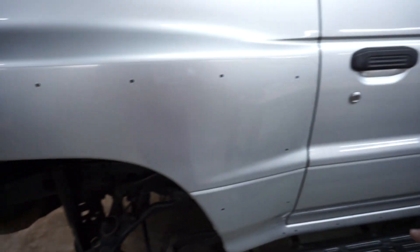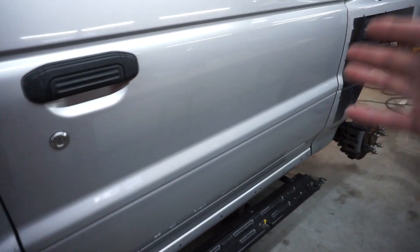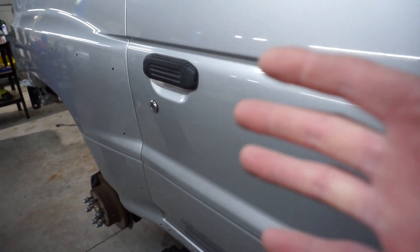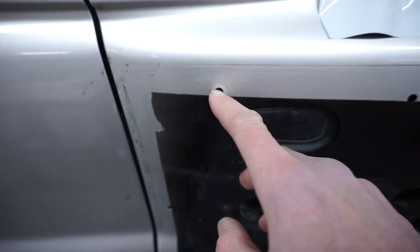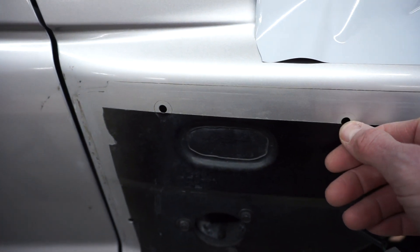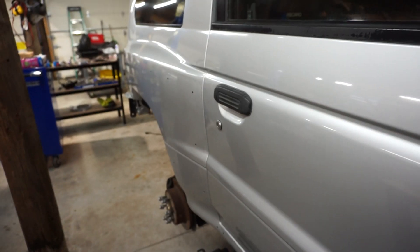Because this had to be removed, the side steps and panels all overlap in a way that requires you to start at the very end at the bumper and travel down the course of the car. So if you're going to do one panel, you do them all. All these clips are very delicate — I'll show you on a fender I have in storage how to get these off easily. It's about eighty dollars in clips to do this because you destroy them when you take them off.